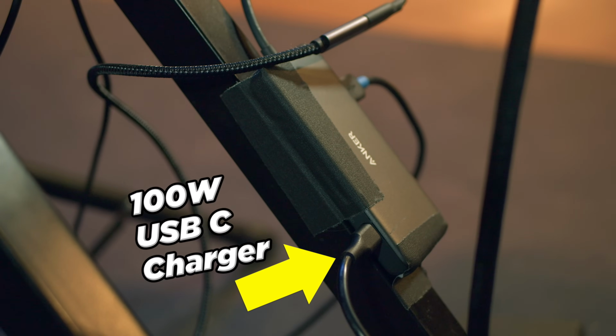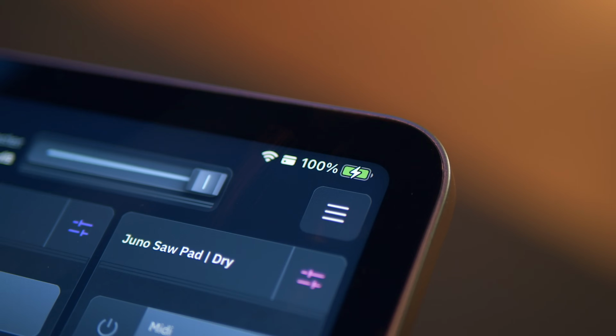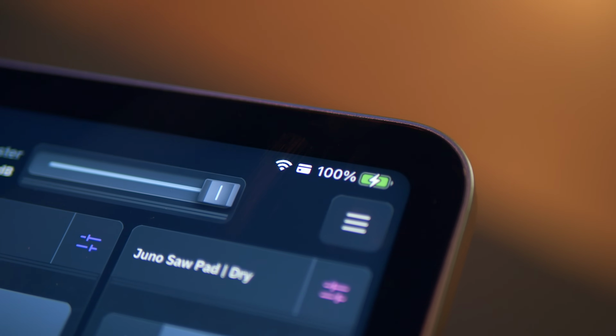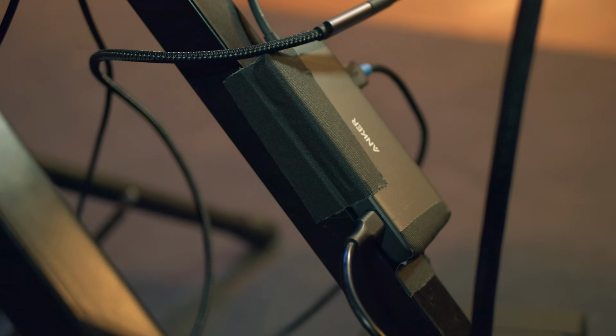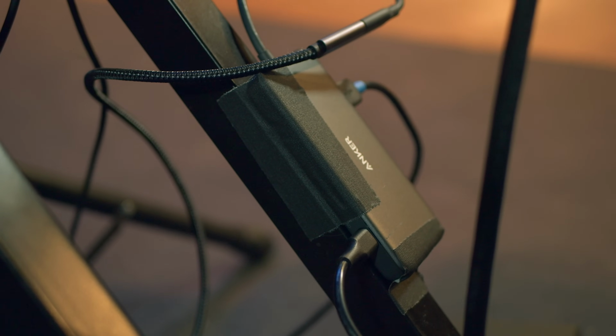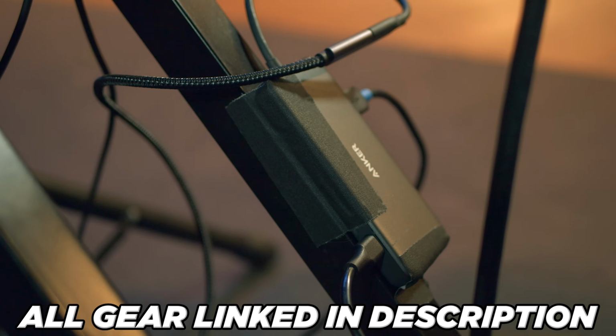It's really important you use a USB hub that supports a feature called power delivery. This means you connect a powerful charger to the hub, and that provides power passing through to the iPad device itself. If you're not using a USB hub with power delivery, best case scenario is some of your devices might not get enough power. Worst case scenario is your iPad runs out of battery while you're actually in the middle of a worship service. So make sure you use a hub that has power delivery. We'll put a link in the description to the one that we're currently recommending.